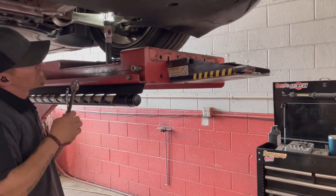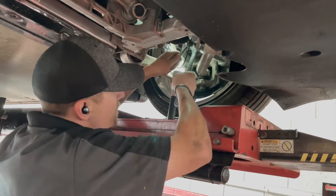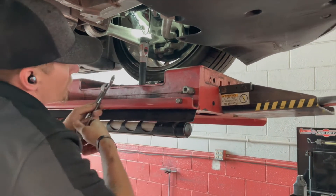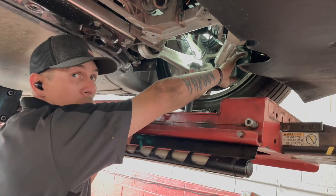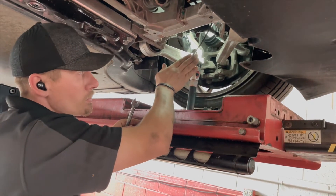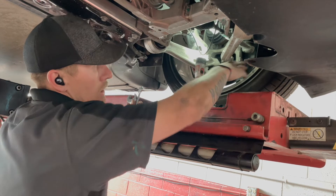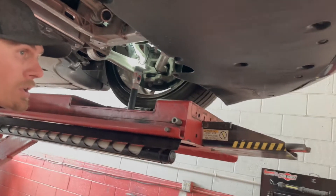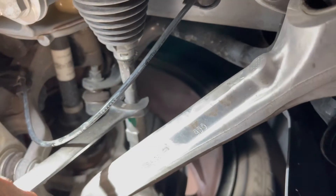A little under 3/4 turn changed it about 0.25, about a quarter degree. Is it the same thing where you have to back it out the other way before you tighten it? Sometimes, not always, because when you tighten the jam nut it rotates the outer tie rod with it and adjusts it again. So loosen the jam nut, make sure the tie rod is at the angle as if you were locking it down, then fine tune. I always bring the tie rod back to center — make sure it's level and not turned in the joints.